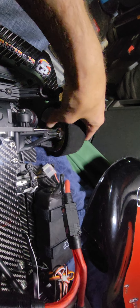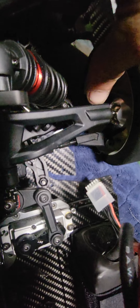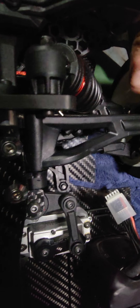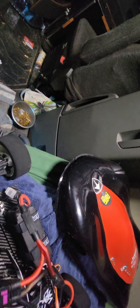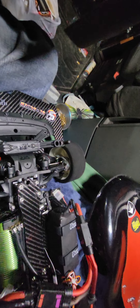I don't know if you can see that play in the servo saver. It's not as bad as it was because I have been messing around with the bushings and everything, but there is still some play. What happens is if you turn to the right, the steering does not want to come back to center — you can move the servo that much with the controller and the wheels won't move. So too much play.